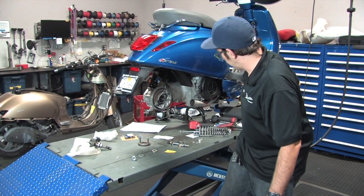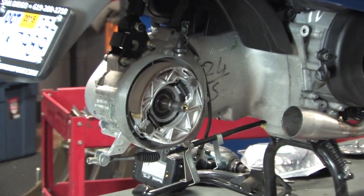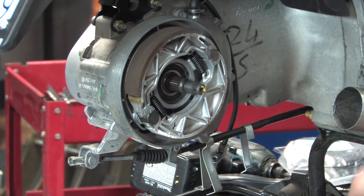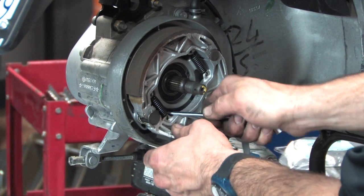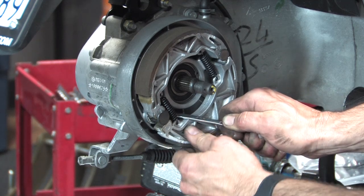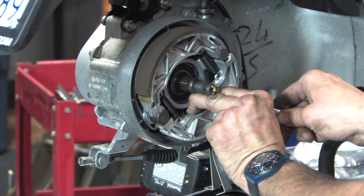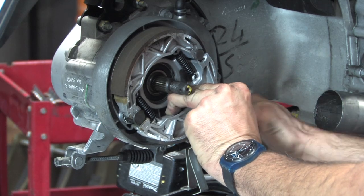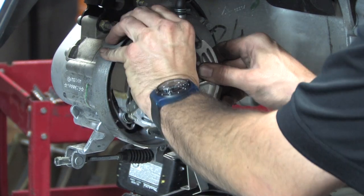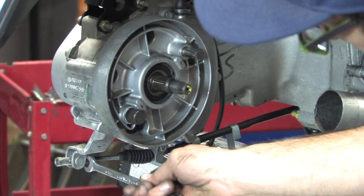If you're going to remove the brake shoes and reuse them, you want to mark the outside — I'll put two little X's so when I reinstall them I know the orientation. They're symmetrical so you can put them either way, but since they're getting reused I'm going to go ahead and mark them. You can just lever the shoes off — obviously be careful, you've got springs under tension here. Once you have it slipped off that pin, you'll be able to carefully pry the shoes off. I'm leaving the springs all intact. Loosen the rear brake.